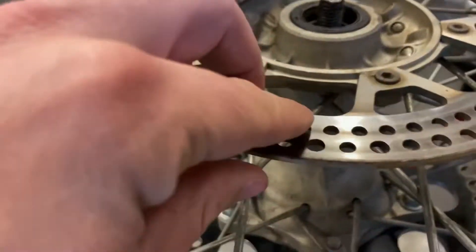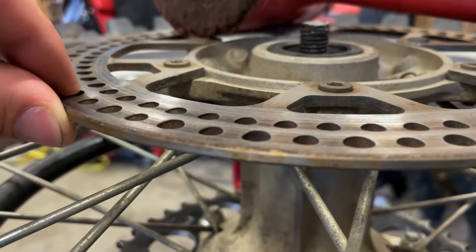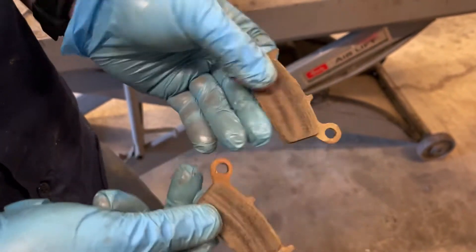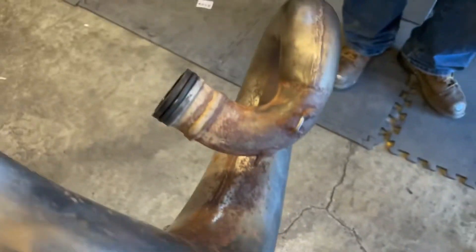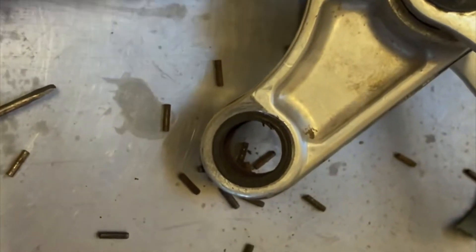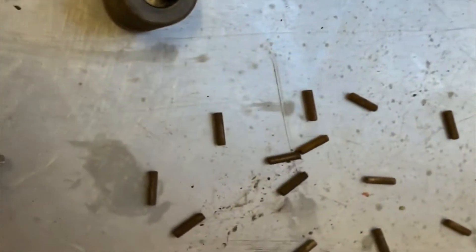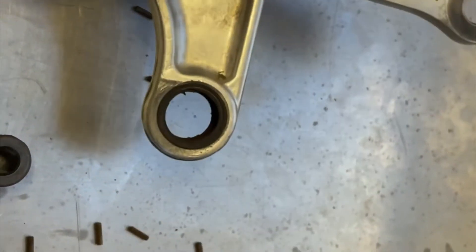After a little more inspection, we're gonna have to order a new rotor — you can see it's grooved out pretty bad. We're gonna order a new rotor, fresh pads — pads are shot — and the brake pin has a little bit of wear to it. Pipe is off. I'm gonna bring this back to my garage and clean up some of the rust. Linkage is out of the RM — pushed the sleeve out and the bearing just fell apart. Again, no grease, which is surprising because the rest of the linkage was greased up pretty well. Let's get a new one in.